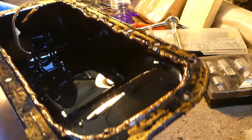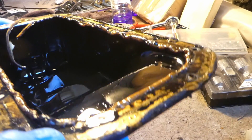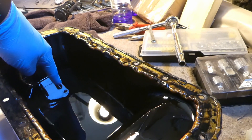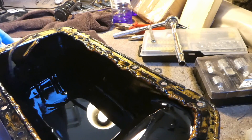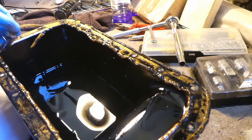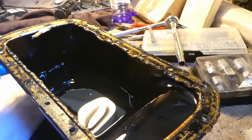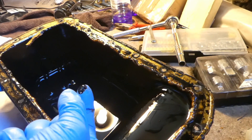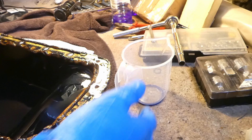There is quite a large proportion of oil down there. This is where the baffle, where the plug comes out — it's recessed slightly, so there is always a bit of oil left. This is from the other oil seal. I'll try to drain it and measure how much is actually left after an oil service.